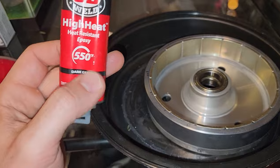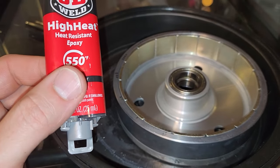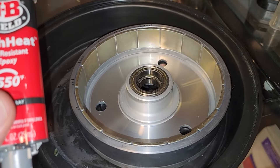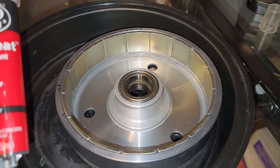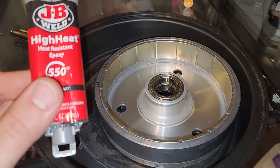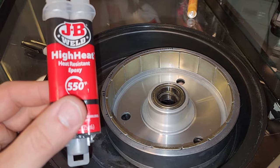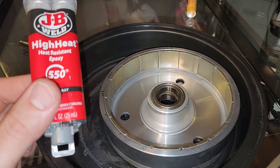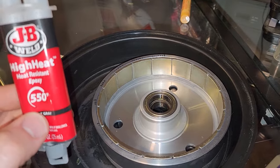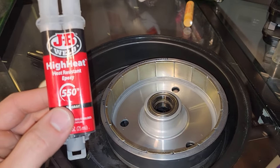And if I did replace all the glue with this, I'm thinking I could probably easily run 72 volts and multiple kilowatts through this motor, probably 4,000 or 5,000 watts, for two reasons. Number one, now I have a great glue holding the magnets in. And number two, those are steel reinforced nylon gears that I'm using, right? And I know aftermarket gears you can even buy that are completely metal. So this motor will be able to handle probably a little bit more heat.